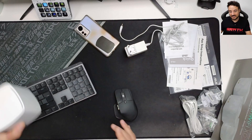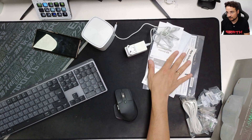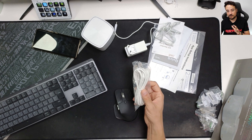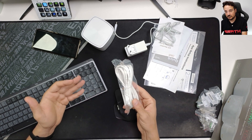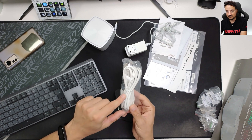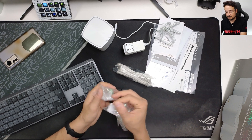Let's take a look at everything in the box. I have my mobile phone here to show you the app you'll use to control these units. We also got a bunch of manuals, and we got the Ethernet cable. I want to point out for those of you who throw away these cables — when you buy a new router, you're getting a high-speed cable, usually a Cat5e labeled cable. Definitely use these, because some people still use an older cable that's not Cat5e, and that means you won't get the full bandwidth.